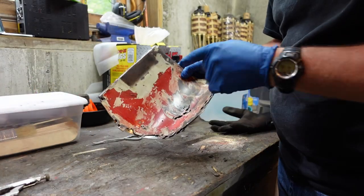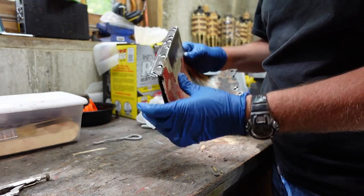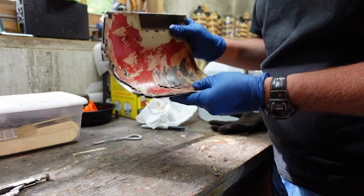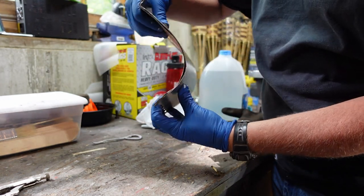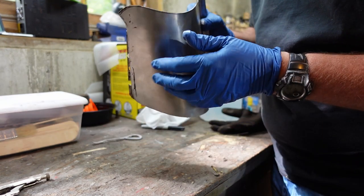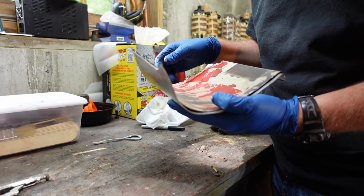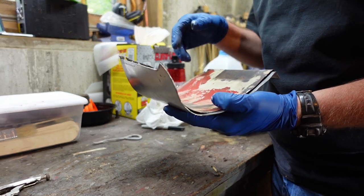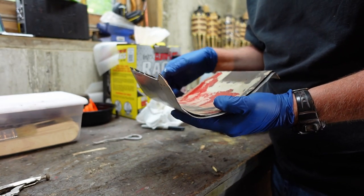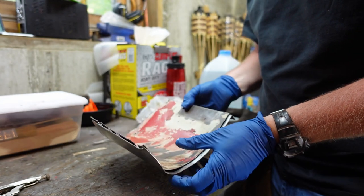I do have the original piece that I cut out here and my replacement piece. Kind of clamp these two together, and I've got to trim this flange a little bit, but everything else looks pretty good. It's not perfect — you can see there's a little bit of a gap — but it's going to be good enough. I'll be able to finagle this to make it work. Get it cleaned up, sized up, fitted. We're going to do this metal first to get it trimmed up.